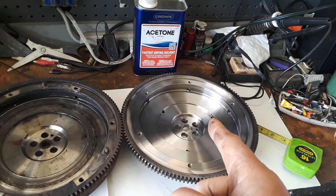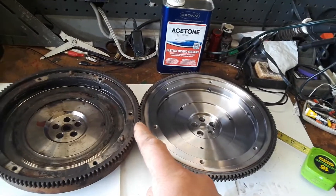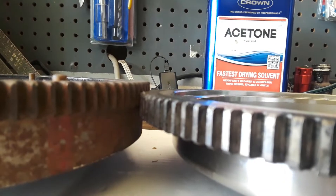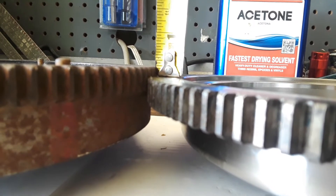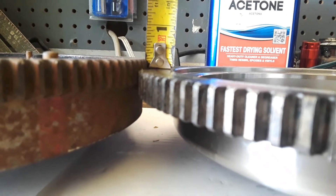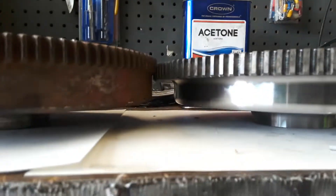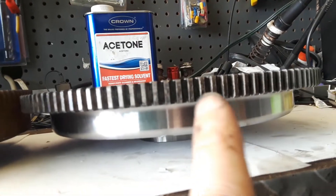Going with the 200mm is better because you've got more options, and you don't have to do grinding in your tunnel. I want to check if that ring gear difference is actually an eighth of an inch — I think on the last video I said a quarter inch but I meant an eighth. Let's measure the ring gears. There you go — that is just a hair shy of an eighth of an inch. They run a little different: this one sits a little higher, and this one runs closer to the engine block, but overall they're essentially identical — except one's rusty and the other's chromoly.